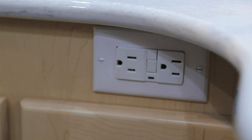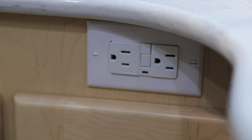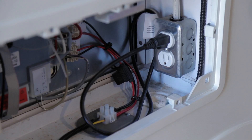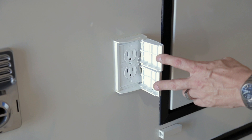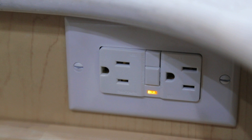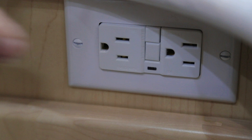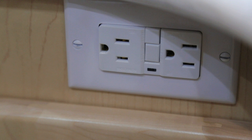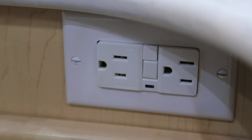Conveniently located in your kitchen just below the sink area is the GFI — a ground fault plug. It will trip if there is a fault in the system and controls the fridge, bathroom, kitchen, and exterior plug on your vehicle. When tripped, a light appears on the plug to indicate a ground fault situation. To reset, push the lower reset button — the light will disappear. If it comes back on, your vehicle has a ground fault situation, which could be your connection to the outside power source, the park source, or a fault in the system — including moisture in the plugs.